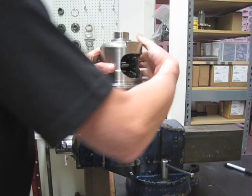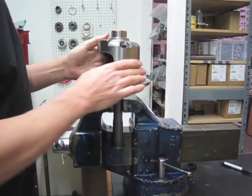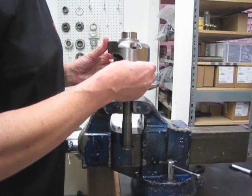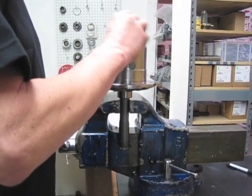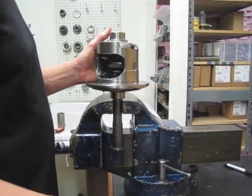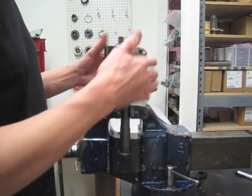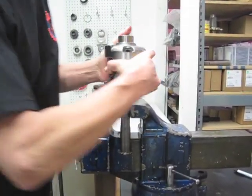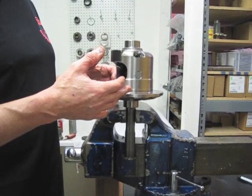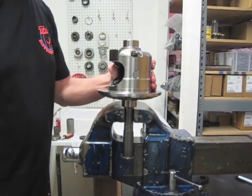That's actually not bad, but when we put it in the machine, it's going to settle up those clutches, and after it turns 100 times it will actually be looser, and we will go back up another 2.5 per side undoubtedly. But if you're doing this at home and you don't have access to turn this, you can sit there and turn it with a spanner wrench 50 times, but I want you to go 50 times each way. You can't cheat. It's very hard for me to tell you how tight it is, but you've got to be able to turn it without grunting and groaning. But of course, you can't just sit there and spin it real easily.